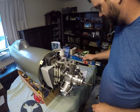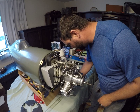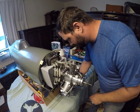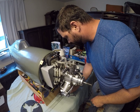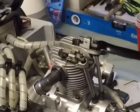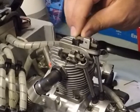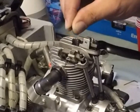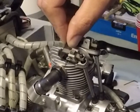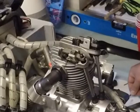Let's see if Saito's limit gauge goes in — that'll tell us if it needs adjusting. The engine is cold. Let's see if it doesn't quite go in. It does go in, so that one needs adjusting. And that one definitely needs adjusting. So let's adjust it.